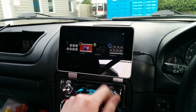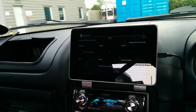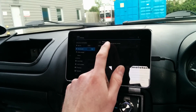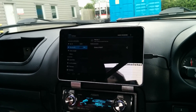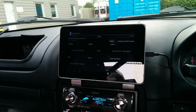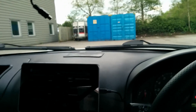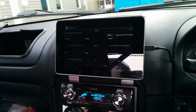I have got it on the gauges to use Bluetooth GPS, but you can see the box is blanked out. Going into my Bluetooth GPS settings and pairing up the Bluetooth — that's my Bluetooth GPS. Almost immediate lock on it, which is fantastic. It's just sat under there so it's got a pretty good view of the sky — just a thin layer of plastic in between. You never know it's there and it connects almost immediately, even from a fresh boot as you've just seen.